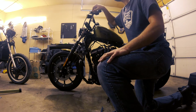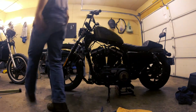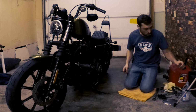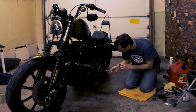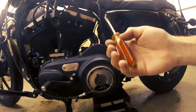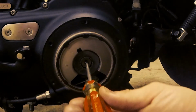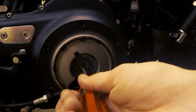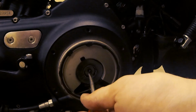As you can see from the last video, the lever and the clutch cable is still loose, so we'll go ahead and adjust that. So we removed that spring earlier. Now, we just want to tighten the resistance screw here, and we're gonna be using a flathead screwdriver. We need to turn it counterclockwise to tighten. So opposite from lefty loosey, righty tighty. So we're gonna turn it counterclockwise until we feel resistance right there. And then we're gonna turn it back 1/4 of a turn.